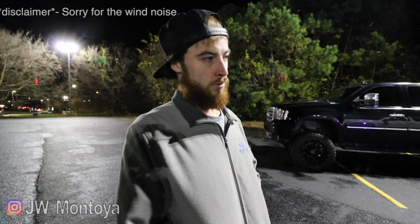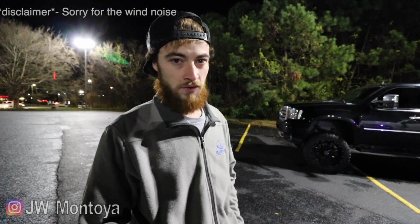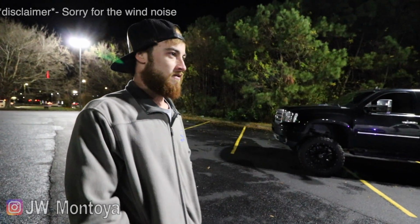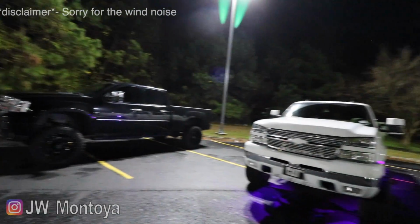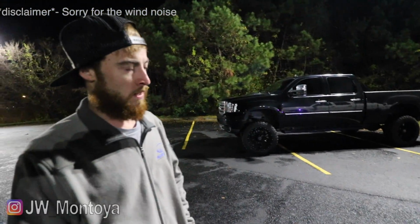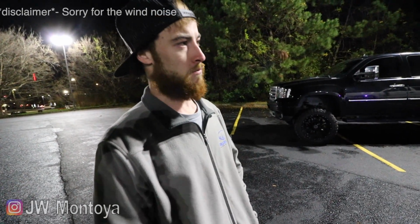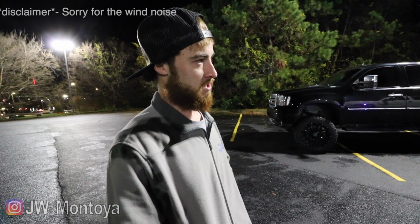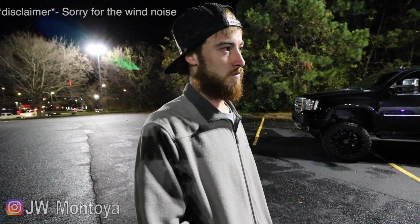So he started thinking my block may have been cracked. He did a few pressure tests on the cooling system, checked everything out, and thankfully the block was fine. So he sent the other head off to the machine shop, and turns out it was cracked. So now it's got 2 brand new heads. I went with the ARP head studs and gaskets, and while I was at it, I added the PPE high flow manifolds and turbo up pipes, which make a huge difference in throttle response and definitely top end pull.